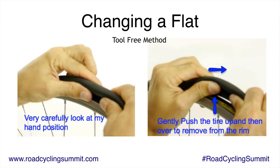Now, a lot of people think this is about strength, and it is not at all. It's about the way you're moving. That's really what it is. So if you look very, very carefully on the left side, precisely how my fingers are positioned. I'm grabbing the tire. Of course, I've already let all the air out of the tire. And I'm grabbing the tire and I'm lifting it, pushing with my thumbs, pushing the tire sort of up. And you see how that gap on the right side starts to open up.